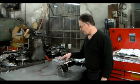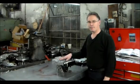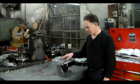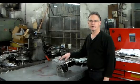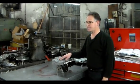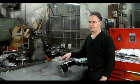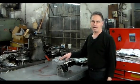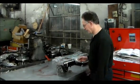Today we have a 2013 Ford F-150 5.0 with a 6R80 transmission, and I'm going to be changing out the lead frame because of a code P0720, output speed sensor. The customer claims that at times when he would take off from a red light, it would seem like it would have no power. So obviously it's in fail safe and starting out in a higher gear.